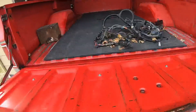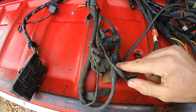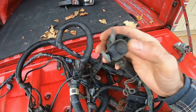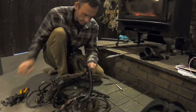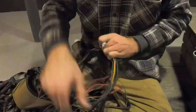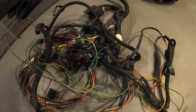You could buy new wires and solenoid to make this, but I just used an old second gen harness I had laying around. The only parts you really need are the solenoids, the heavy cables, and the little trigger wires that have the caps on them. I started by stripping down the harness just enough to get the length of cable and trigger wires that I needed. It's a little messy and tedious, but the price is right and once you're all done it works great.